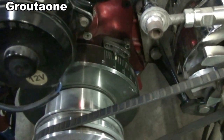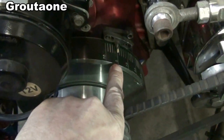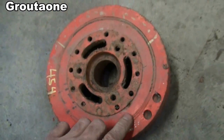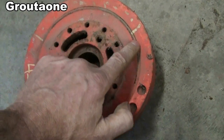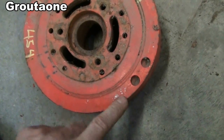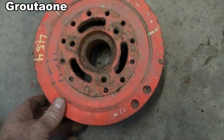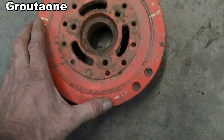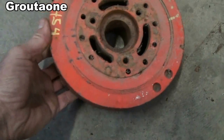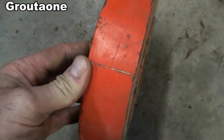Here's the front of my engine - you can see my harmonic balancer right here with all the numbers on it. This one is made by a fluid damper. Most of them are not referenced like that. I'm going to show you another one made by Chevy. You see this line here? It's like an elastic divider between the outer shell and the inner portion. What happens on these is the outer shell will sometimes shake its way into a different position from where it was set at the factory, and when that happens, the timing mark is no longer accurate.